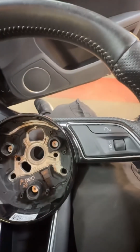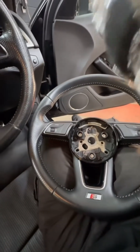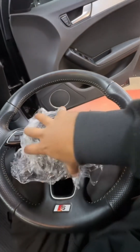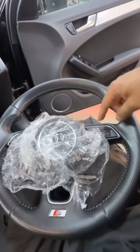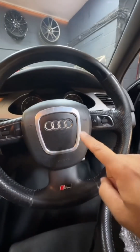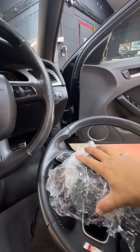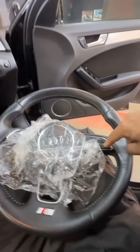The basic one that has just the mode and up and down buttons, which kind of matches what's on his car now. However, being a B9, I'm not sure if the buttons speak a newer LIN language. I'm not sure if that will plug in there and work. The airbag I can make work. It won't have an airbag light. I can do whatever adjustments I need to do on that. But I'm not sure about the buttons. We'll have to find out.